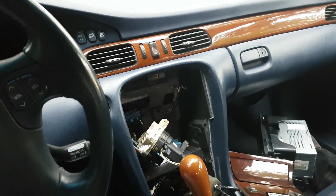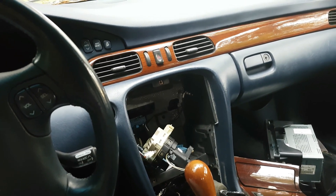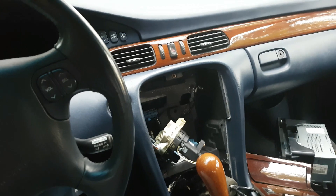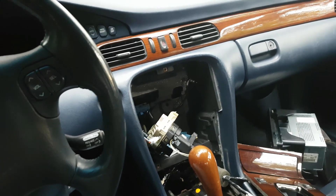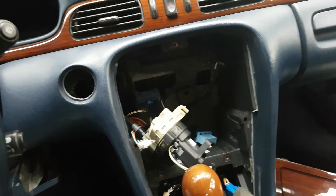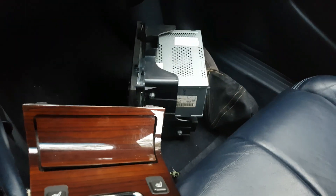I didn't get video of taking everything apart. The reason I picked up the camera for this quick video is that at this point in time I can only find one other video on YouTube showing how to change the switch in this car, and that video has the guy saying you have to take a knife and cut this part of your dash out. I just wanted to show that's not necessary at all. You start by taking the console piece off, then there's one bolt up here and two bolts at the bottom to take your head unit, navigation unit, and heater controls out — and the switch bolts up in there, and that's where your cylinder would be.